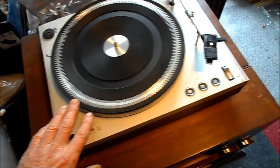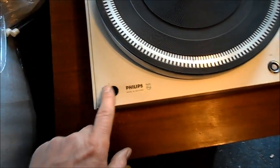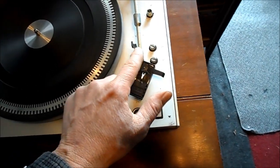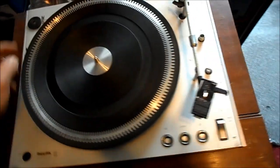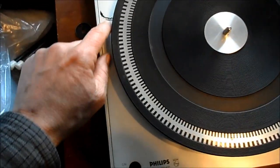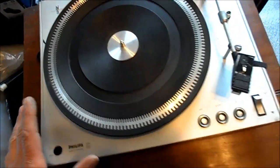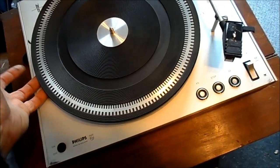Let me go into some of the pitfalls it already has. The power switches fail, and I hope maybe it's inside, but this is a donor machine. The head shell here has seen better days. The tone arm holder is broken. This residue here is from the belt — when the belt goes on these, it turns into this tarry, disgusting, almost tar-like substance. I'm sure this one has that disease.